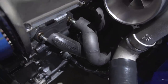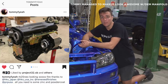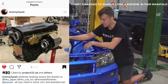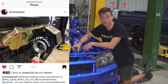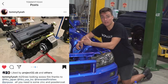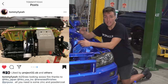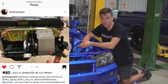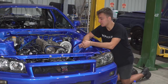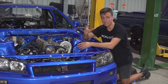If you want to go down the cheaper route, you can do it a few ways. You can use the standard exhaust manifold which is made out of cast iron — keep the turbo low mounted — but you're going to have to buy yourself a spacer if you want to fit a turbo this size or a little bit bigger, to space the housing from hitting the actual engine block. The disadvantage with that is the cast iron manifold is a very poor design. You're never going to get your car to sound right, and if you start pushing a little bit more power, heat and boost through it, you're most likely going to crack it as well. And if you want to go for an external wastegate you're going to have to weld something on the back of the housing or the manifold itself, which is also an added cost along with the spacer.